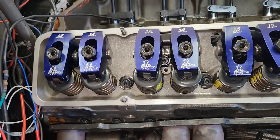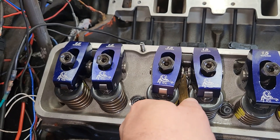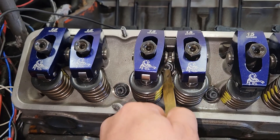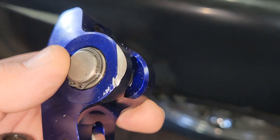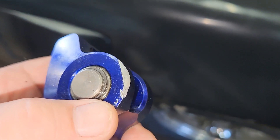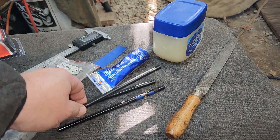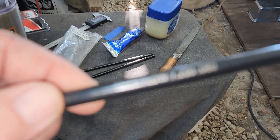I didn't mention this in the video, but on this rocker arm I did grind it down. This is with the 7.2 push rods and there is ten thousandths of clearance. Let me show you how much I grinded it down - that's all it took to get it to clear. But you can see right here it was still hitting there too, so it wasn't completely clearing. I just used a flat file to grind that down - it's aluminum so it grinds down easy. So we have both our 7.2 push rods - Trick Flow 7.2, 80-wall thickness.